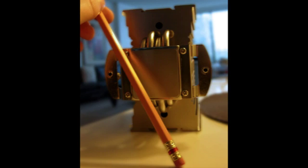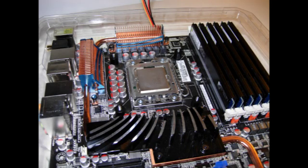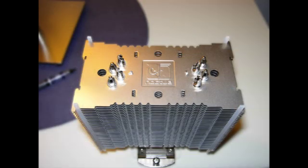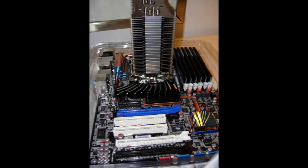You can also clean the bottom of your CPU cooler. Next, install the backplate with the four provided screws. Put the four plastic spacers on, and on top of those put the two provided brackets — you can put those either on the left and right or on the top and bottom, which will change the orientation of the CPU cooler. Next, secure the brackets with the provided screws, then mount the two brackets on the CPU cooler and glue the four rubber anti-vibration strips on the fins.